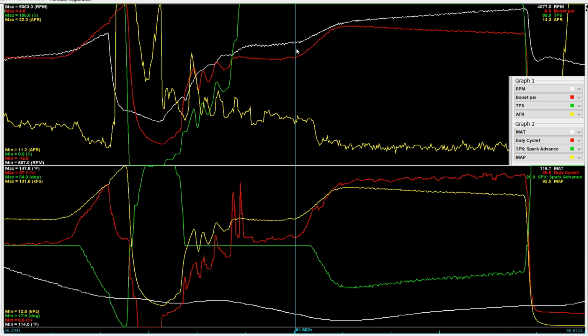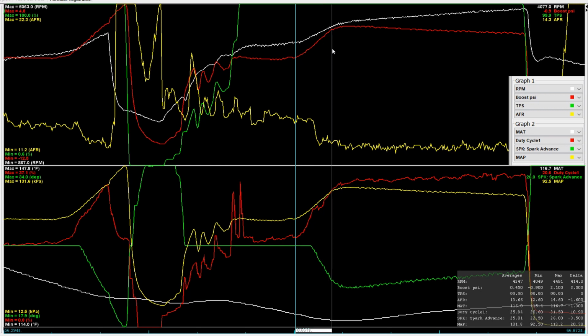And you saw I slowed down the hit speed, so it's less stress on the bolt on the impeller. And looks like we got up to speed in about 0.9 seconds. That may be a touch long if you count this little leveled off area, but generally I've been seeing about 0.75 to 0.8 something. So, you know, it's a good speed. It's a good amount of time to ramp in where I feel it's safe with the bolt.